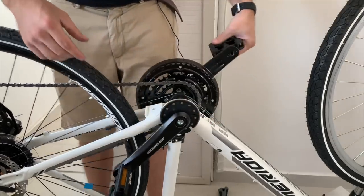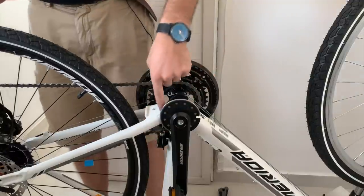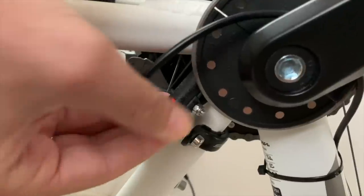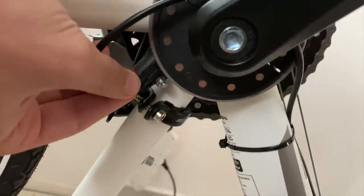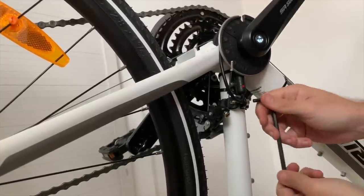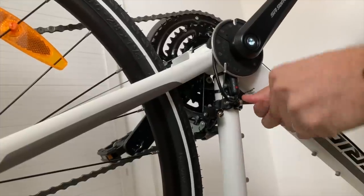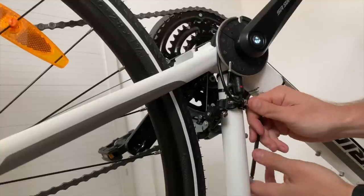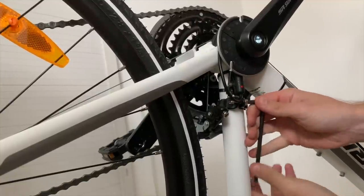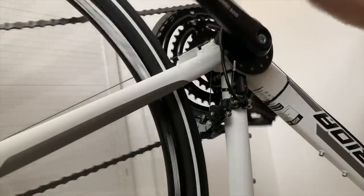The locking ring is on and that looks pretty good. The next step is mounting the sensor, but the tubes are pretty thick so I managed to get it in by raising the derailleur mount slightly — just a couple millimeters — which gives just enough room to get the sensor aligned radially with the magnet ring. I'll need to adjust the derailleur cable length slightly. Now when I turn the pedals, the blinking indicates it's reading each of the magnets. It works.